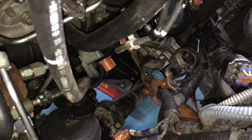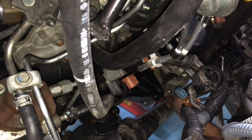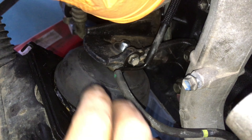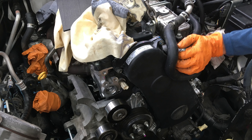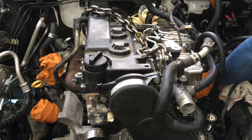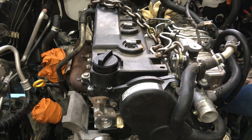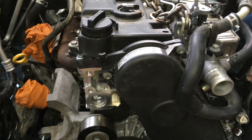My left arm is stressed out holding it in that position. Okay, I'll let go. Oh it's beautiful — that's what we want! So the bell housing's on, the engine mount on the driver's side is sitting nicely — put the nut on, beautiful. Look there — the passenger side engine mount's on and the nut's going on right now. She's sitting in — the bell housing is bolted up and both engine mounts are bolted up. We can get the chain off the top.